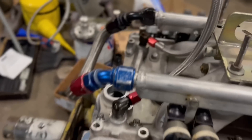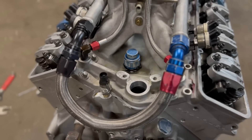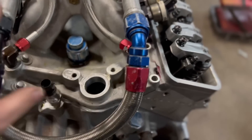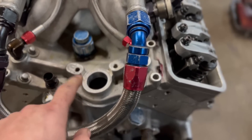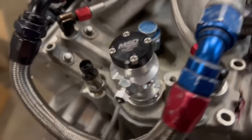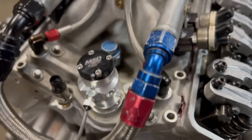Another thing - the way I've got this fuel line run back here, this line is getting kind of hard and it was pressing up against the firewall real bad. I think what we're going to do is get a 90-degree fitting - I think I've got some close 90-degrees - and try to do a 90 like a little loop and go up so that the line is off the firewall. Got the new MSD piece. The MSD cam sync install: you loosen the collar, take the gasket off, put it down until it bottoms out, then put the gasket back on - that pulls it up the perfect amount.